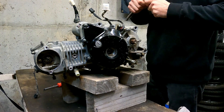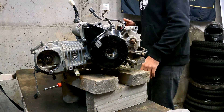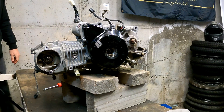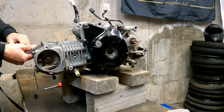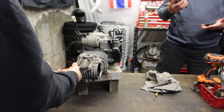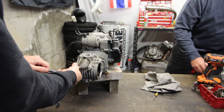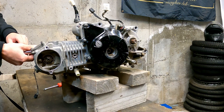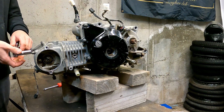Unfortunately, even in a lot of proper motorcycle shops this kind of stuff is almost seen as too hard — it's overlooked. It's definitely not hard to do. It's just: slap some oil in there, change the filter or wash out the screen, and that's it. Even if you take your bike for a pre-purchase check, no one's going to look for that kind of stuff. You can't see what the internal engine is like.